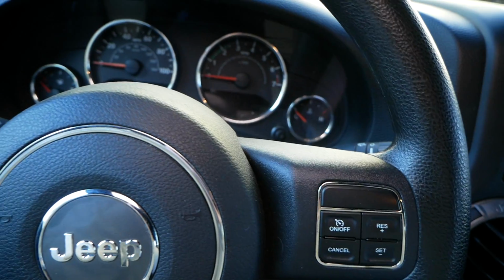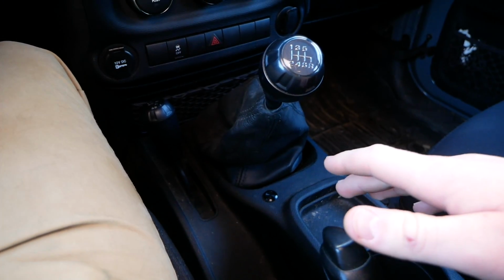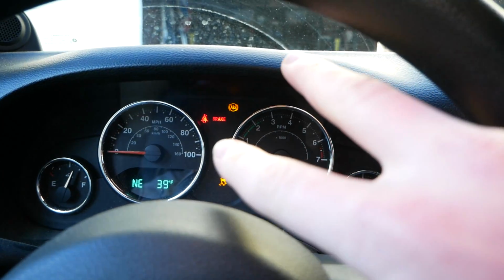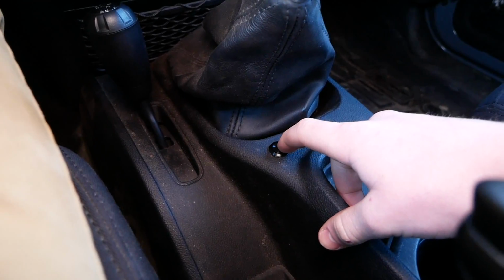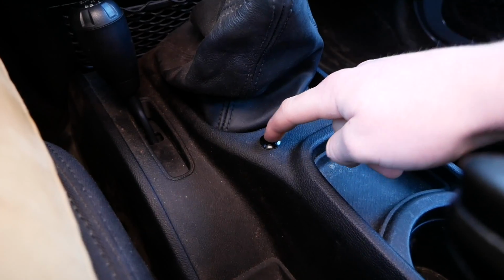Guys, I'm not gonna lie to you, I messed up with this button. When I just tested it out here, I noticed that this is actually set up backwards. As you can see here, when I turn it on, both lights stay on, which means this switch is breaking the circuit, and it's only a momentary switch, and it only engages the circuit when you press it.